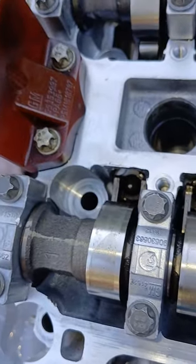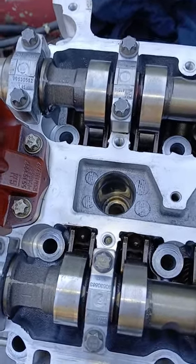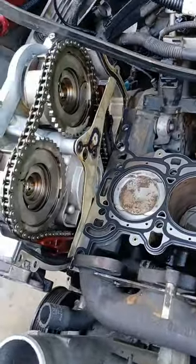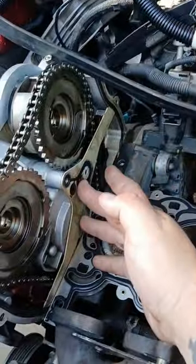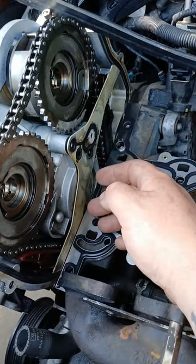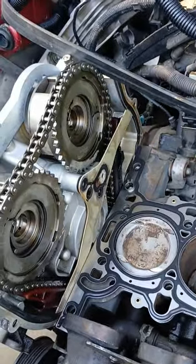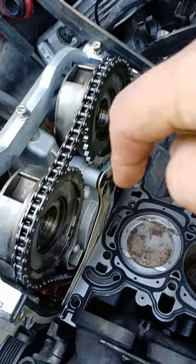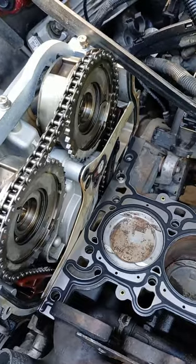Before I took it in, I made sure I could verify this thing was at the correct timing — glad I double-checked. Got the head gasket on here, got it cleaned up pretty good. I didn't bother cleaning the pistons because it doesn't really matter. I probably needed to replace all this but it still feels very pliable, so if it doesn't seal off I'll have to come back and replace it. Not only is it for lubricating in there, it also goes up and comes back into the head, and right in here are the ports that control the variable cam timing — because on this system I'm pretty sure it runs off of oil pressure.